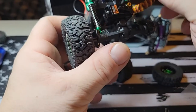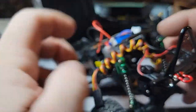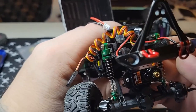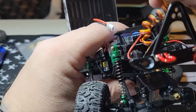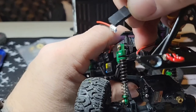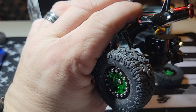The new servo's installed. That coiled-up wire is going to go up through here. Put it over the headlight wire - that'll hold it and keep it up. Leave yourself enough for suspension travel. Try to pull it back so it's not getting pinched in the frame. Then plug it in. I'm going to use the needle nose pliers for that because I can't get in there with my fingers.